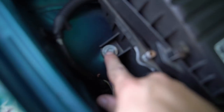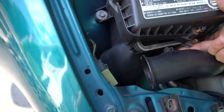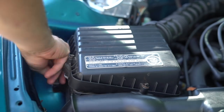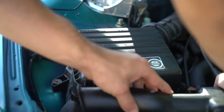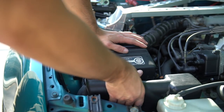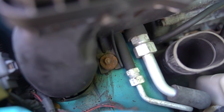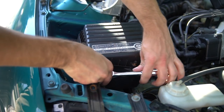The first things that you want to remove are right here — a little 10 mil — and right here, also another 10 mil. There may be another one somewhere else; all you got to do is remove it. We're going to remove these two right now. This air intake has more than one piece — it goes from here all the way down under the fender. This piece pops off and wiggles right off, which also revealed a third bolt down there. This one is a little bit rusty but we'll get it off.